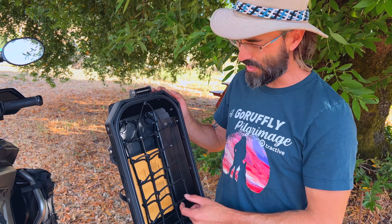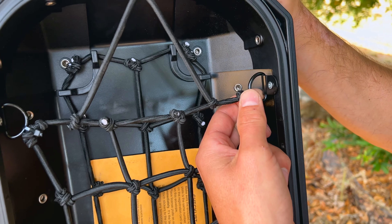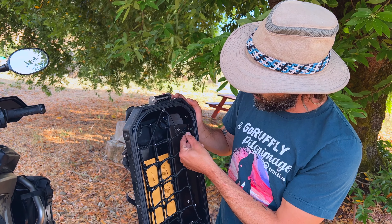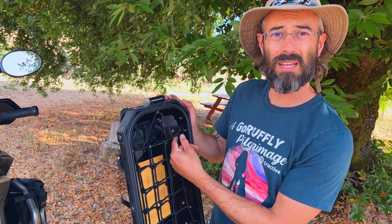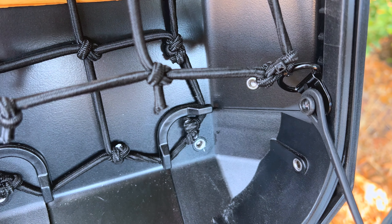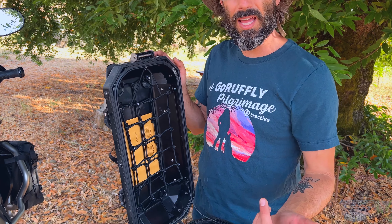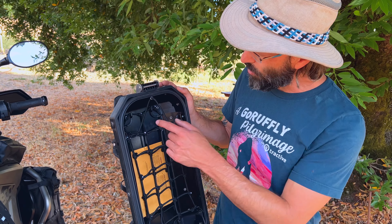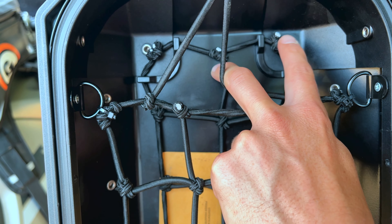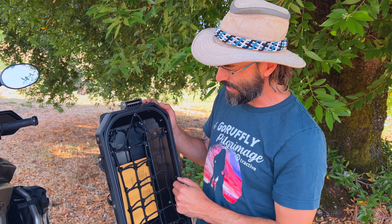Or you can do this, which is to basically put a cargo net in the lids of your panniers. I'm not sure if GV has their own setup, but I like a good DIY, so what I've done is secured these hanger deals right here and cut out a cargo net to the size that I need. There are little spots here of plastic that can receive a screw, so a wood screw on either end secures the hanger, and with a zip tie, we've got our lid nets.